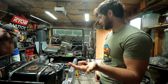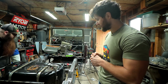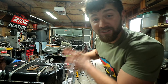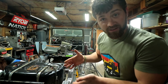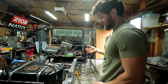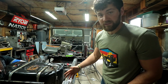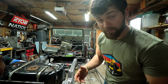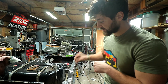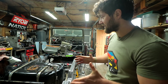A lot of parts are in transit, a lot more parts need to be ordered. Obviously the frame needs to be painted — we'll wait till everything is installed before doing that. We need to get a longer driveshaft, extend the fuel lines and brake lines, and there's a lot of stuff to be done. But this is a huge step, because you don't want to rush building the frame — structural integrity is number one, and it needs to be square for drivability. That's why we've really been taking our time and making sure it's done right. I don't know a whole lot about welding, but I've picked up a lot of good welding etiquette — like not rushing it, because if you heat up one side too much it's going to start warping, so you go back and forth between sides letting each side cool down.